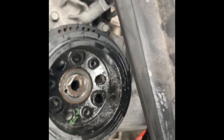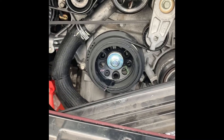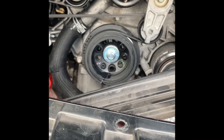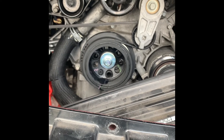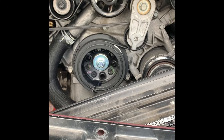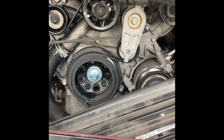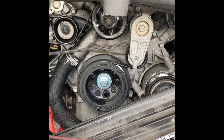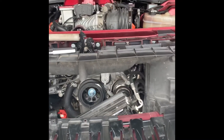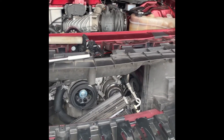This is the last video — she's torqued to spec. I did a little extra just because I've got the supercharger on top, so I went by the Hellcat specs. I believe it's 148 foot-pounds and then you do another 150-degree turn to make sure it seats in, or you can go with the old spec of 228 foot-pounds of torque. I'm going to put it back together and crank her up — we'll see what happens. Thanks for watching.